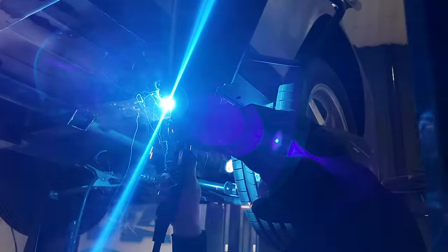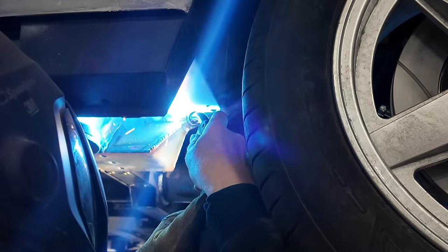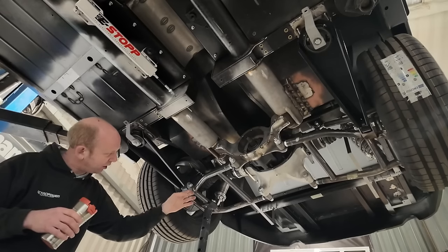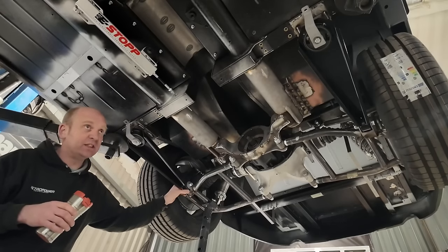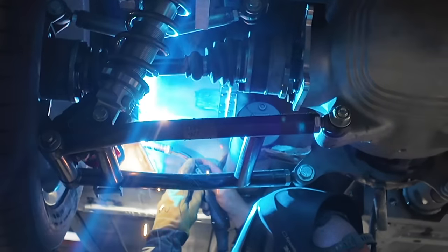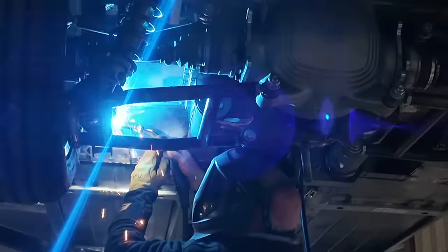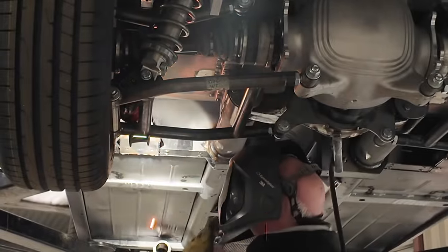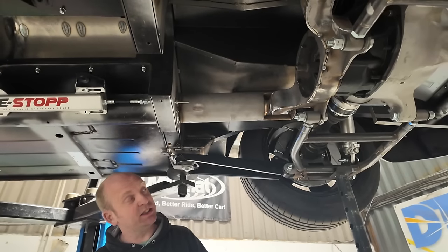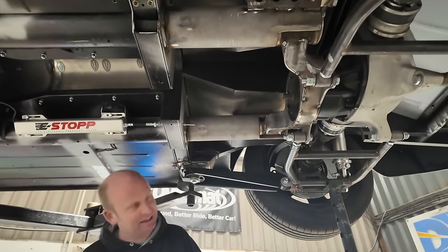Conveniently, the mounting positions on the body shell tie in really nicely to where we'd want to feed the loads in — where the rear chassis blades meet the main chassis cross-member. Stew fabricated the rear mountings, made new brackets to attach the radius arms to the wishbones, and made minor extensions and widening tweaks to the Heynes mounts. With those tweaks the Jaguar radius arms fit really nicely, compliance in the bushes is exactly right, and everything works perfectly.